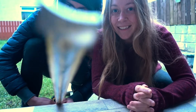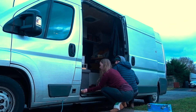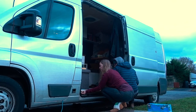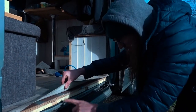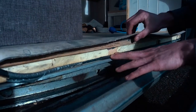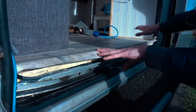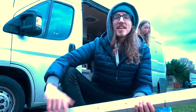Let's measure. I've got it up to the edge of the sill. You need to put a step on here just to cover this. This is our floor and our insulation, and we do have a wire running across here — that's for our split charge relay, which goes from our vehicle battery to our leisure batteries to charge them up while we drive.